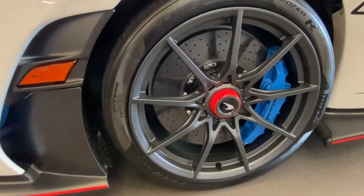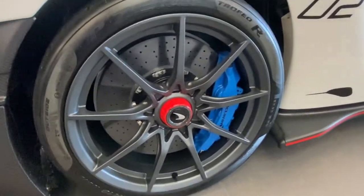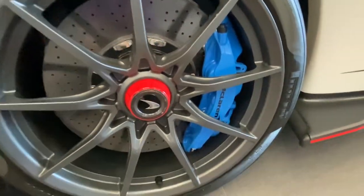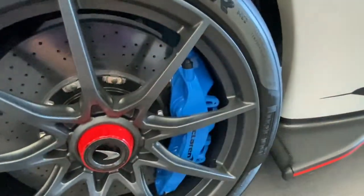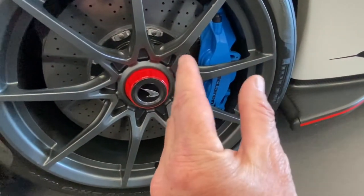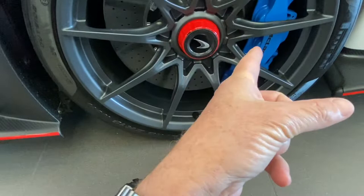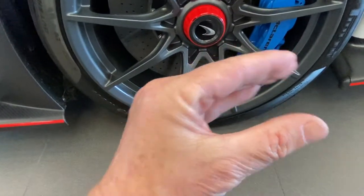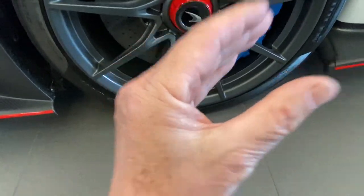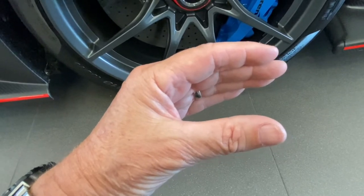The Senna has become very famous for its braking system — 390mm rotors up front, 380mm on the rear. The caliper is absolutely enormous, cut away in a skeleton shape to save weight rather than being a big monoblock type. The clever innovation is that the caliper is not mounted straight on the disc — it's on a slight angle, so that under the huge hydraulic pressure of full braking, when it flexes, the pad ends up completely flat on the rotor. An amazing innovation.